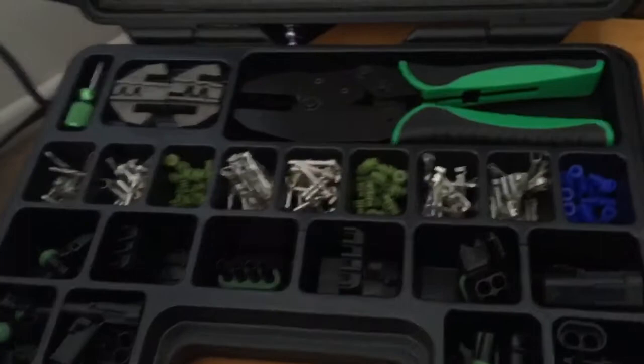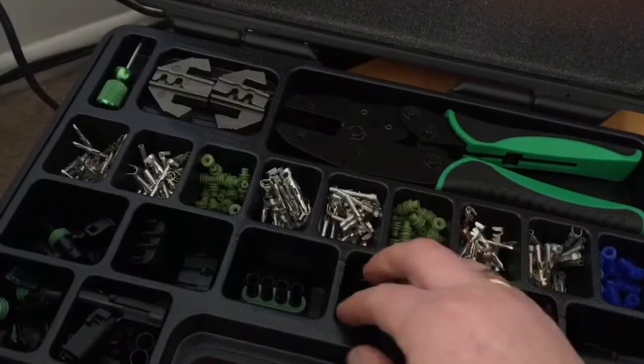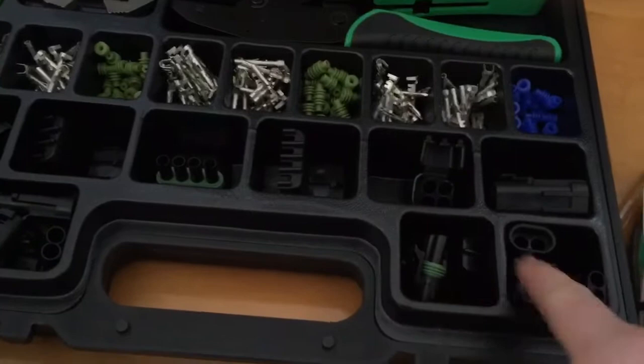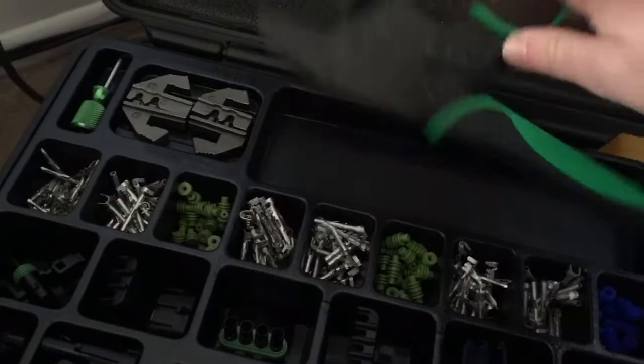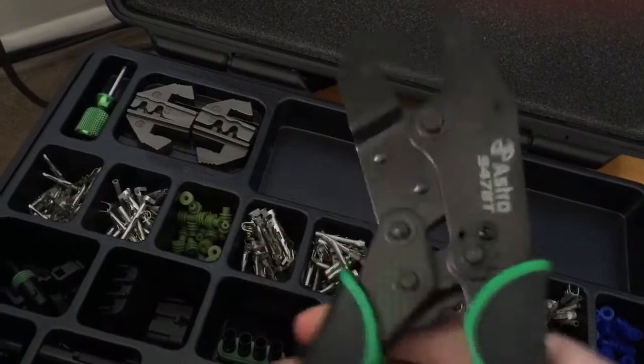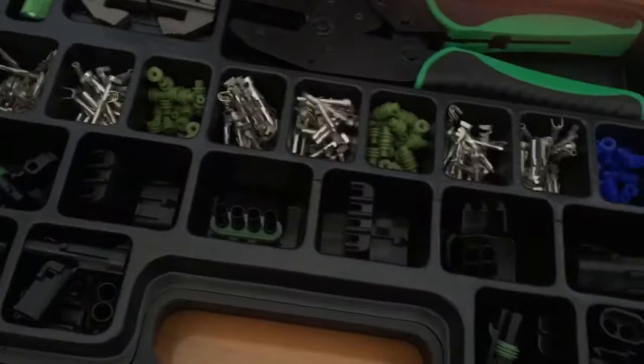I also bought a 90-something dollar kit — about 200 pieces. It comes with various connectors; obviously it's counting all the pins and all the insulators. So a four-way, two-ways, one-ways, a couple of different ones, and one of these four-way square ones. It also has a nice set of crimping pliers with removable, ratcheted jaws. And then obviously the little screwdriver to help you get the pins out when you connect and disconnect them. I think it's a pretty cool little kit, obviously going to be used to help wire up the truck.